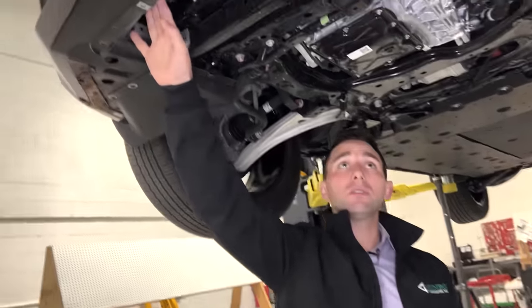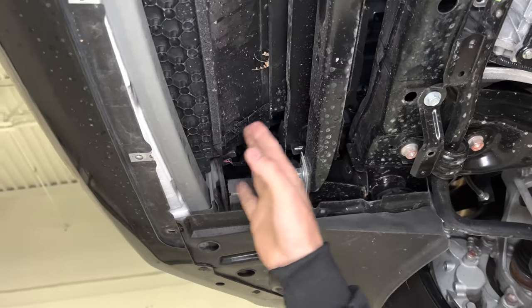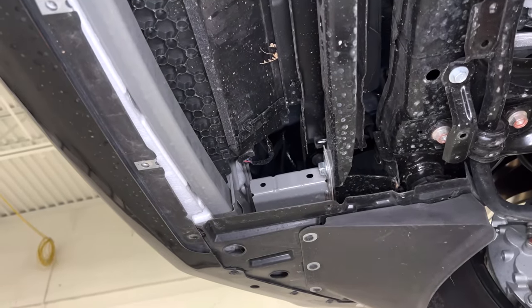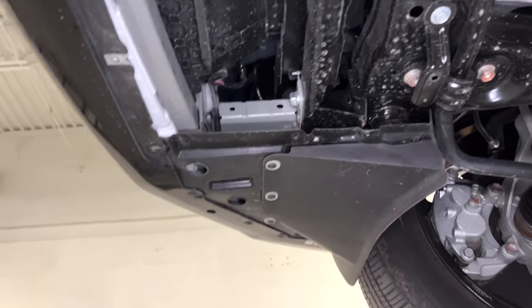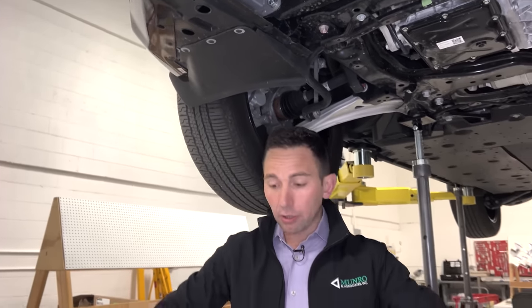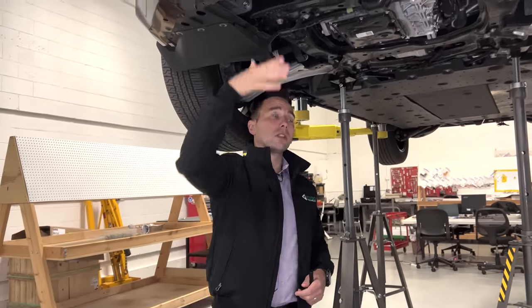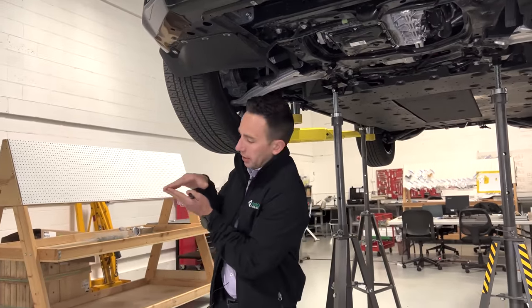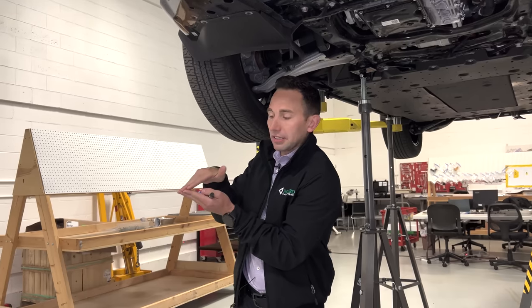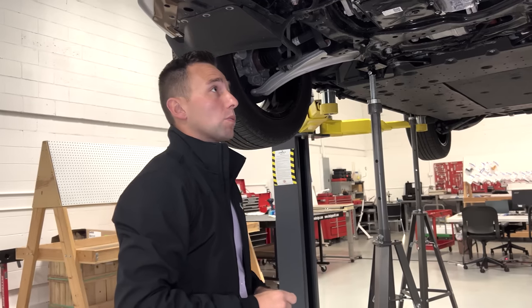The other thing that they're likely doing with this member is this is going to be a pedestrian protection enabler, especially in Europe, right? There's a major requirement for these vehicles to have a very planar and flat front end. And so having monuments in the lower end of this fascia so that you don't get a structurally very narrow front end of the vehicle, they're likely using this for that as well.